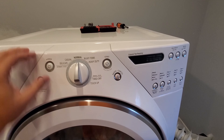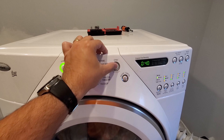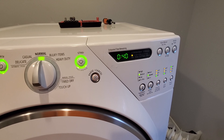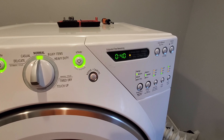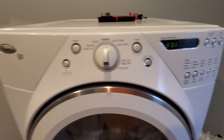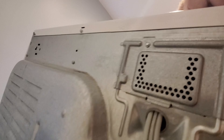So here's the problem we're having with our Whirlpool Duet. Turn her on, go to dry — F-01. Some people said unplug it, stuff like that. Tried that, unplugging it for a few minutes out of this portal right here. If you actually sniff it, you can smell a burnt resistor in there. So I'm assuming something happened to the board.